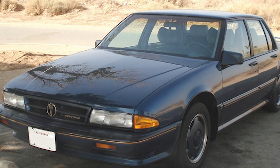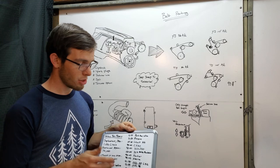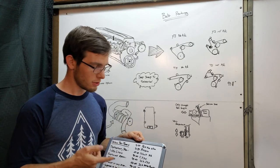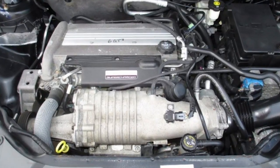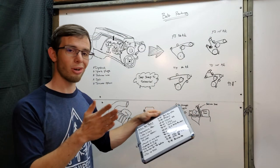As well as the Oldsmobile 88 LSS and 98, and the Pontiac Bonneville — all had the Eaton M62 from '91 to '95. But they're different sizes. For example, the Cobalt is a very long supercharger — it's got a long nose and a long end at the back.